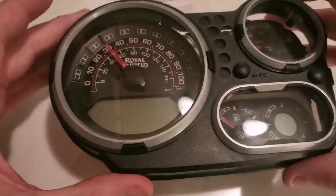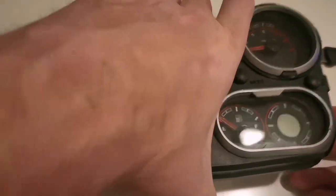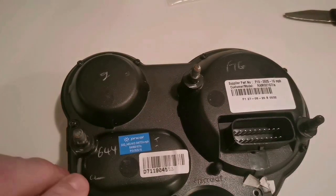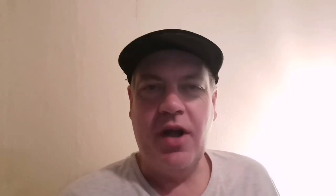Let's see how this pops back on here. I'm going to screw this down nice and tight so there's a good seal against that little rubber o-ring I've put in there. I know that was a little bit unusual, but it's something I know really well. Obviously I'm not doing this in a vacuum — there's moisture in the air in here, so even though it's nice and dry when putting that sealed unit back together, there's still going to be a tiny little amount of moisture inside. But that little silica bag in there is more than enough to soak up any residual moisture in the air inside this now.